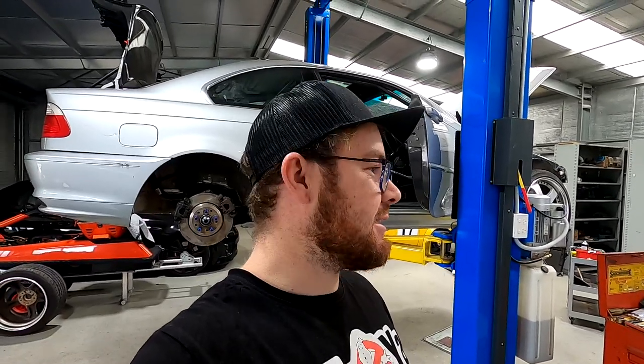Big thanks to TJ E Media for shooting that footage of the car on the dyno. Car's back — made 295 kilowatts at 5,500 rpm and 530 Newton meters of torque, so she's gone pretty good. I think the injectors are running out of go just at the top end, so we're not revving it too high at the moment. Maybe at some point I'll chuck some different injectors in and raise the rev limiter, but for now it's at six and a half thousand. Overall really happy — was expecting a call from the tuner saying something wasn't working, but that call never came. Just called me to let me know it was done.